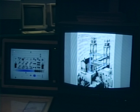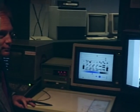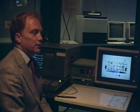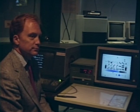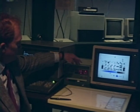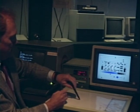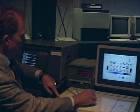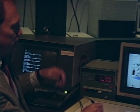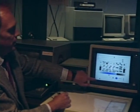Tell me something about the device in the middle there. This box is just the controller for the tablet. The controller sends pulses through the tablet itself, which are sensed by the pen and analyzed in terms of time to determine where the pen is sitting on the tablet. That results in two numbers — an x-coordinate and a y-coordinate — which determine where the pen is on the tablet. Those are reported to the program, which then translates that into a position on the screen, and thereby a button — if I push down here, I'm going to activate this button — or a place on the screen when I'm painting.